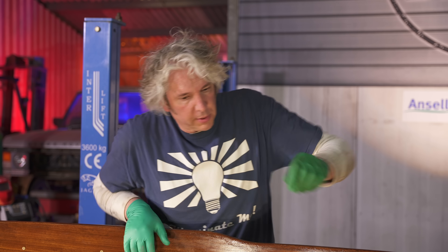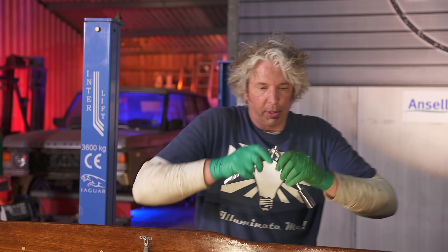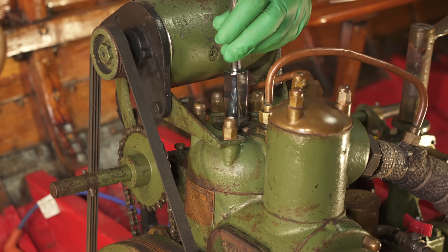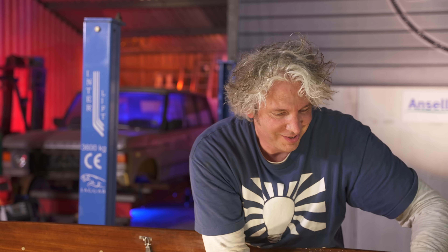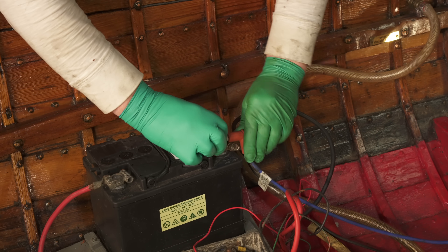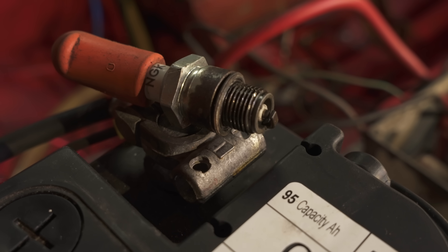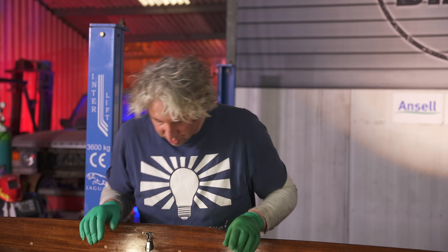So the next thing to check is a spark. Let's just pop off that lead and then take the plug out. Now, I haven't put any fuel in yet — a good top tip is to not try your spark just above the cylinder head there, because there's going to be so much fuel and air inside there that you get a nice big blast of flame. So I'll just pop the spark plug back into the lead and use the battery as my earth. Here we go. Oh, look at that — we have spark as well, which is rather great. So I can pop that back in there. Now what we need is a bit of fuel.